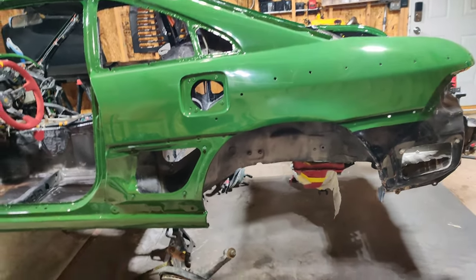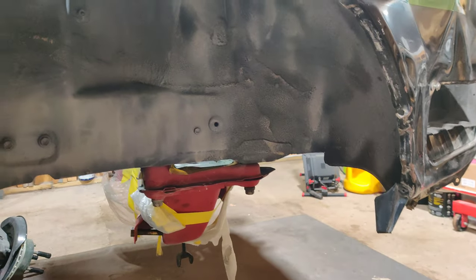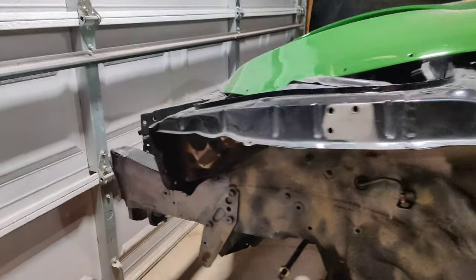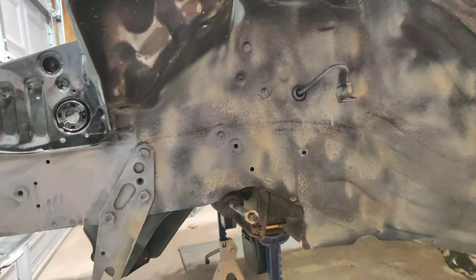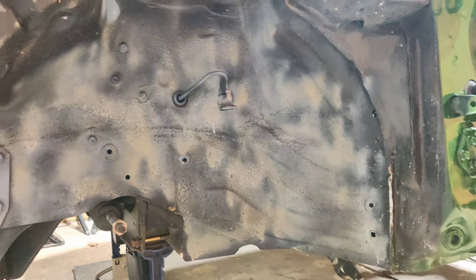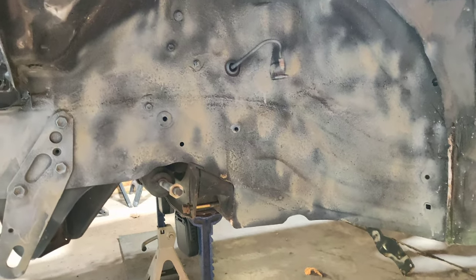This is going to conclude our episode for today. I did run out of etching primer, but I did etch some of these bare metal spots that I could get to — same thing for the front. I got some runs in the front because the can started to run out, but I'm okay with that because I'm going to re-sand this again with the same grit and do another coat of etching primer to make sure I get all the adhesion I need. These areas are the ones I really worry about getting wet and rusting.